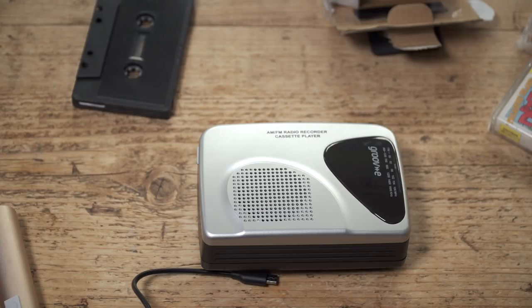I haven't tested the built-in microphone. That's completely useless and redundant functionality. Why it's there and the money isn't spent on improving other bits of this unit, I don't know. I'm completely unable to load from it on the Spectrum. That, I suspect, is mainly down to the lack of volume output. Although what is going on with all that interference on the Spectrum, I have no idea when the unit's coming out of USB power. As a loading device for a Spectrum or other computer, the unit is also completely useless.